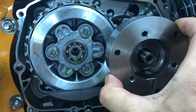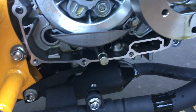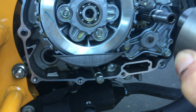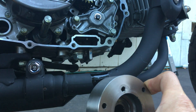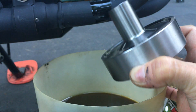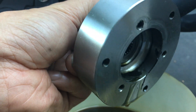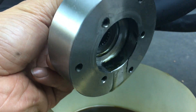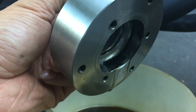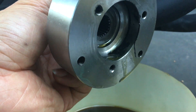Now this thing should just slide right off because there's a spline on here. Be mindful there's a little bit of oil there, so make sure you have your oil pan positioned. This thing is actually almost one piece — and it's pretty heavy, it acts like a flywheel. So there's my spinner — there's some crud in there, you can see that. That's about 200 miles right there, and there's still some metallic, so there's still some break-in happening — probably aluminum. And all the black dark stuff — that's the clutch material.